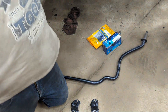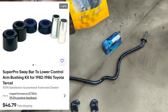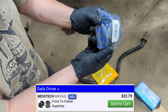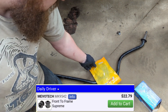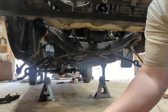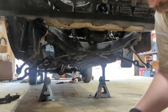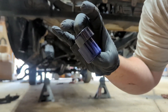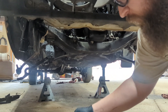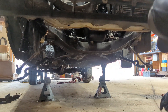These are polyurethane front sway bar bushings. They're available on eBay — only like 45 or 50 dollars last I looked. These are new bushings so we're gonna throw all this stuff in here and get it all bolted up. There are two different sizes: a tall one and a shorter one. I'm going to guess the taller one goes towards the front and the shorter one goes towards the back where the threads are — but we'll see.